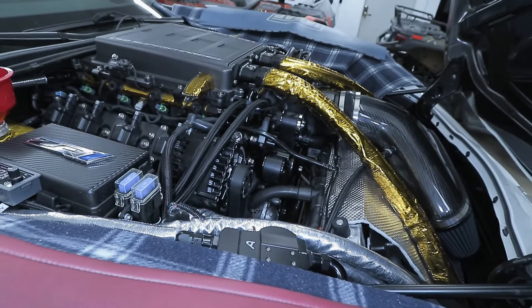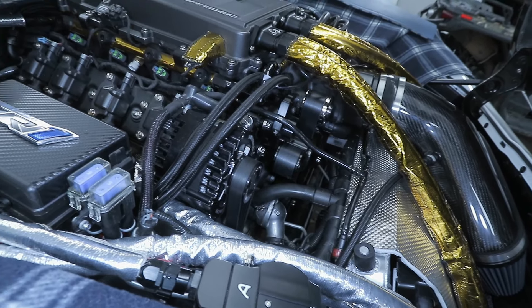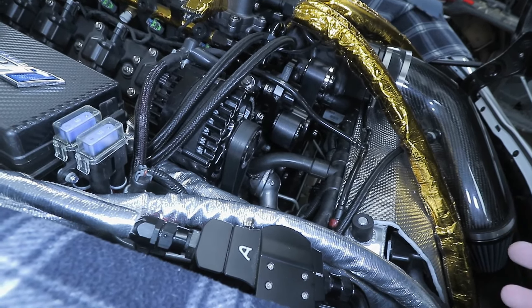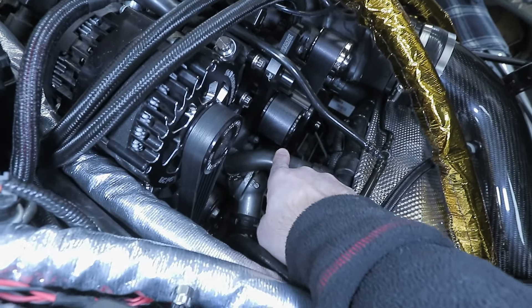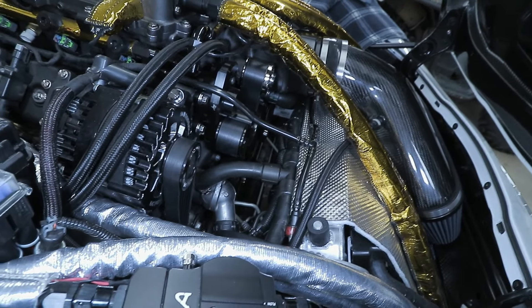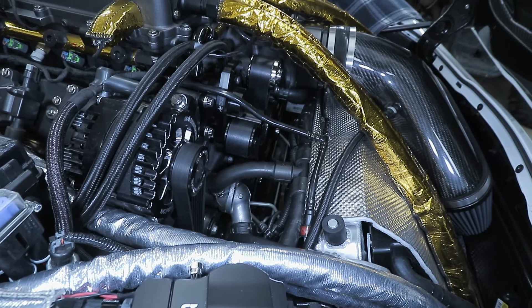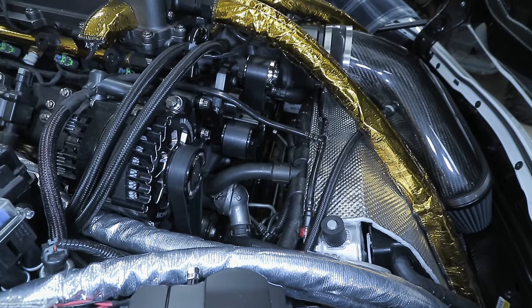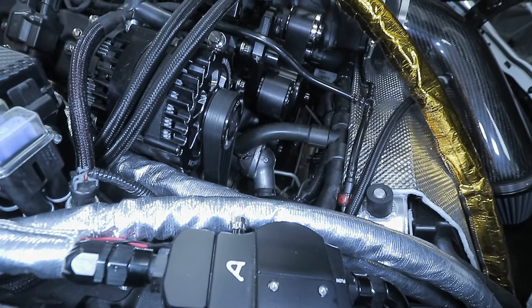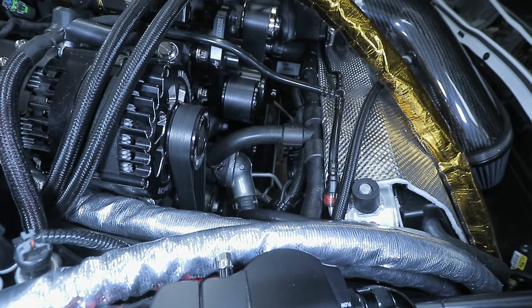The other issue I had was with the Kong Performance Dual Idler Tensioner. This hose was touching the tensioner right away, because you have to place the hose assembly on top of the upper fan, which pushes it up further than before — right up against the idler pulley. You want at least three-eighths of an inch clearance, enough for your pinky, to allow the tensioner to swing back and forth when under boost. I had to shorten the OEM coolant hose about 3 inches total, then clamped it back down. Now there's plenty of clearance.